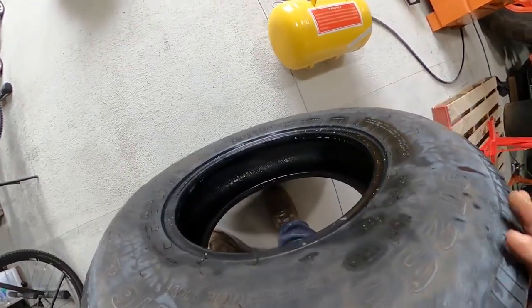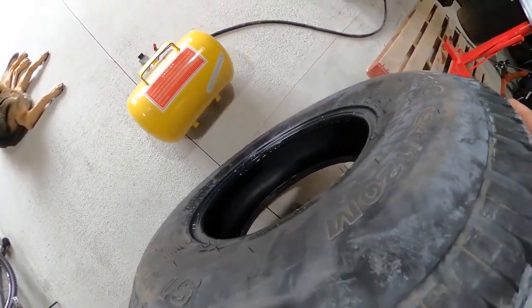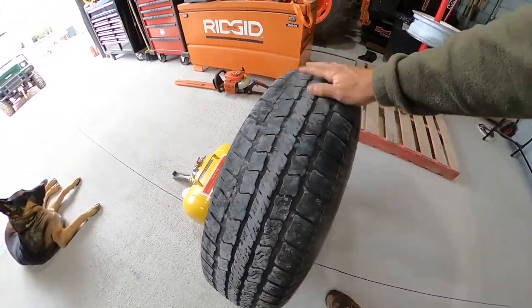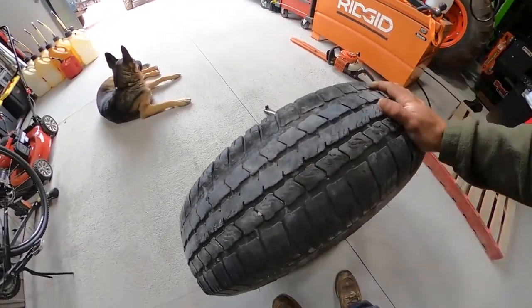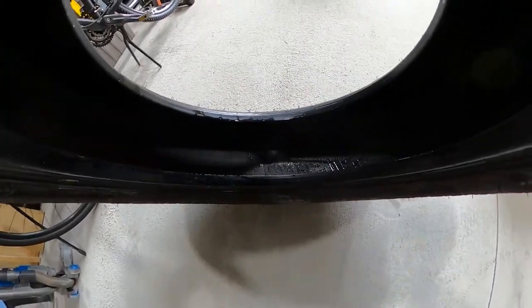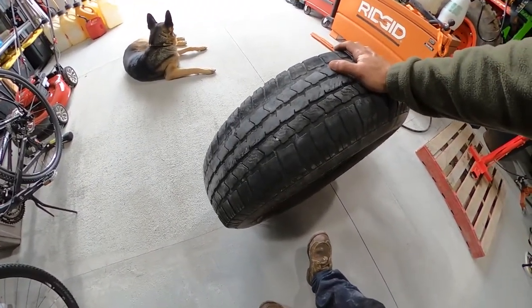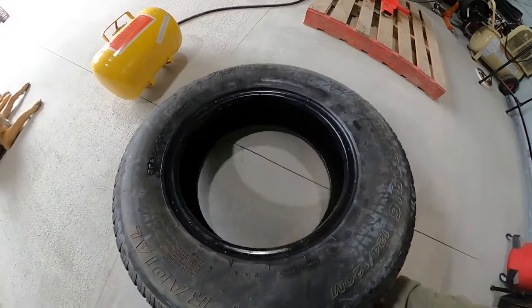I want to show you guys something. You see how the inside is wet because I sprayed water in it, but you see how everything is good and smooth? I actually need to rotate this way because the bubble's on this side. You see that huge bubble right there? That bubble is the spot where our tread was messed up. Just wanted to show you what to look for. What was happening is the inside of that tread actually separated and eventually it was going to start leaking. Normally they don't blow out — they just start leaking because the tread works through the rubber. But let's get the new tire on the rim and get it aired up.